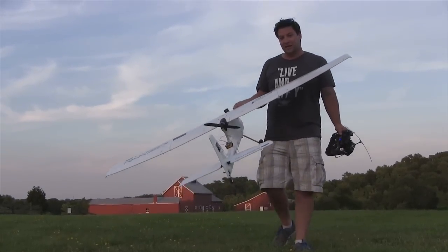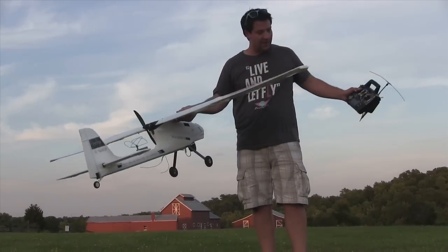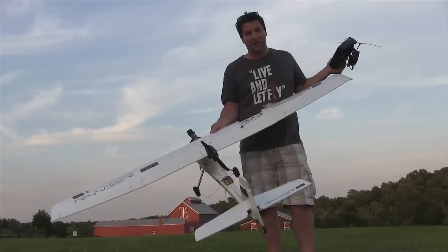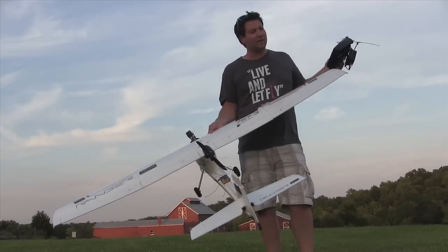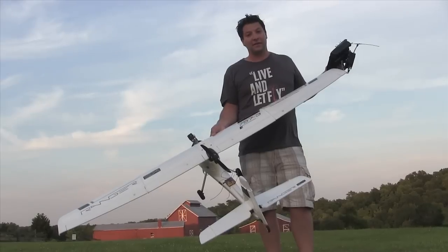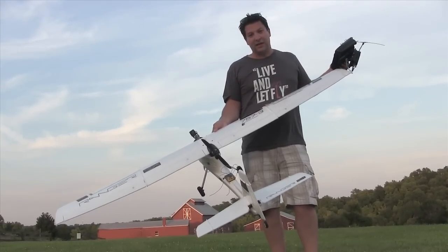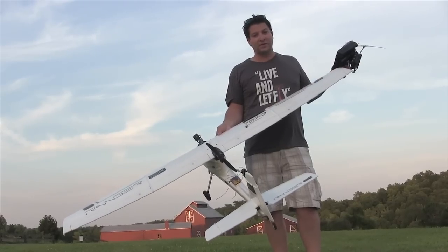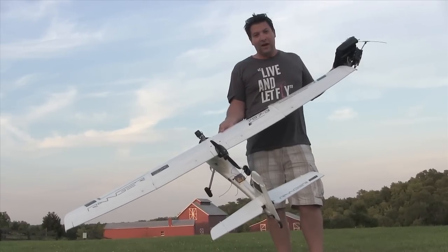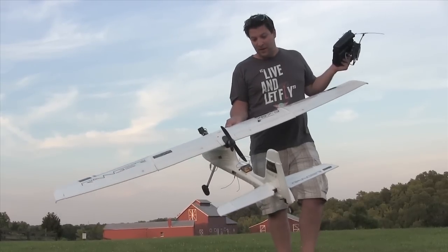Okay, so apparently she's got some torque-induced roll, so I'm going to have to counter the torque roll by changing the aileron setup and trimming. It's not wanting to bank left — I had to induce rudder to get it to roll over. That's what I was fighting to get off the ground; I couldn't keep it stable. Even though I had a lot of aileron control, I didn't have enough to counter out the torque. We'll see what happens on the next go.